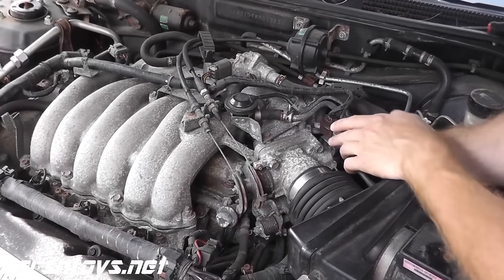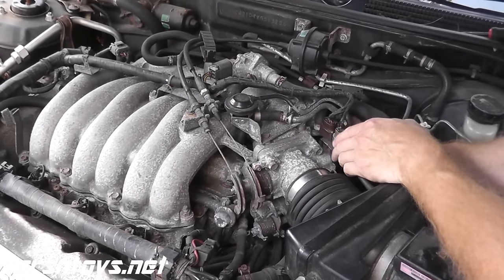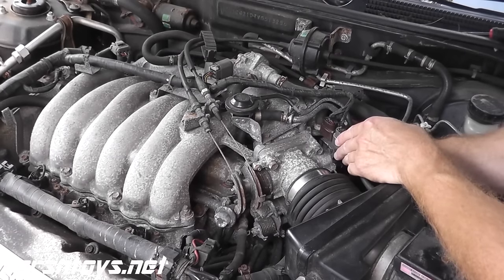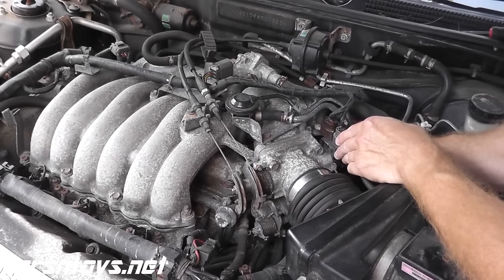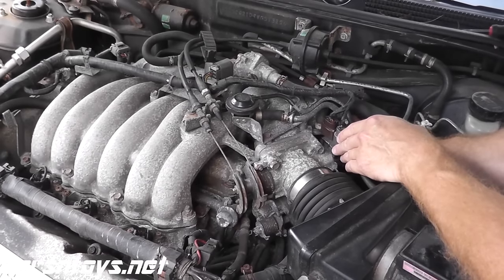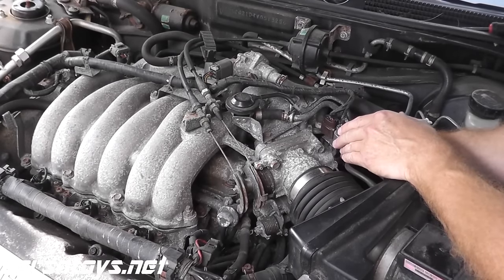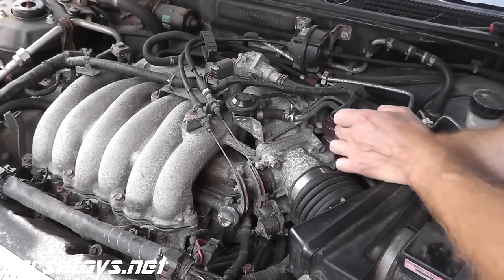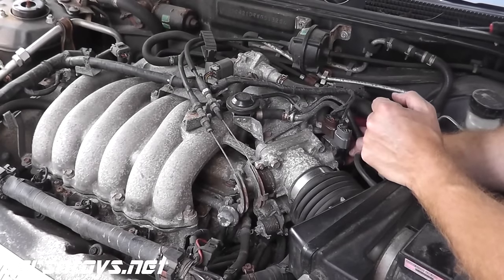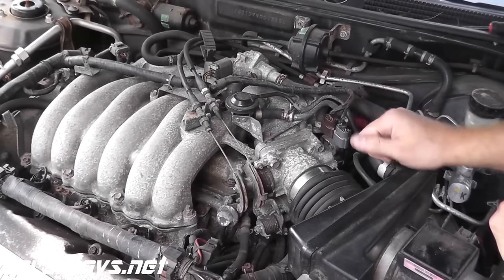So I'm going to rotate this and we'll see the change in idle speed. You see it just clicked up — a little too much. We'll bring it down. And it's a little too low. As you adjust this, just check the RPMs. Once you find the right sweet spot, tie down these two screws and you'll be in good shape.